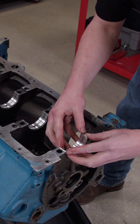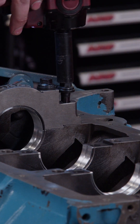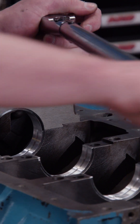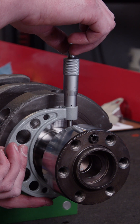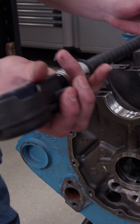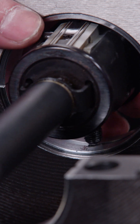As always, the first part of the assembly process is measuring oil clearance on our main bearings. Since the undersized bearings are basically brand new, we are going to reuse them. The ARP main bolt kit is torqued to 70 pound feet, just like final assembly. For each journal, we'll set our micrometer to the journal size and use the micrometer to zero out the dial bore gauge. Our clearances come in between 19 and 20 ten-thousandths — that sounds a little tight, but it's well within the OE spec.